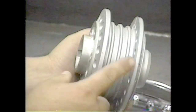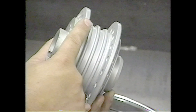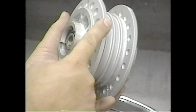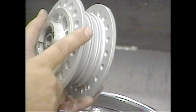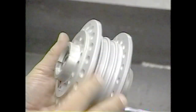This wheel has a symmetrical hub, meaning both sides stand up and are both the same height. A conical hub would have one side possibly bigger than the other, so you would have two different angle spokes, and each of those angles would have two different length spokes. Being symmetrical, we only have two different angle spokes, all the same length. So let's sort the spokes by angle.